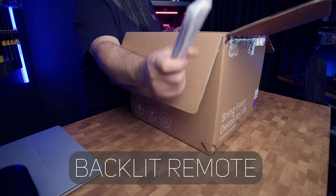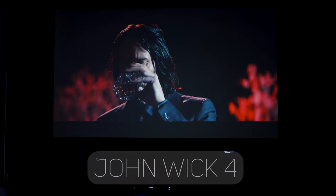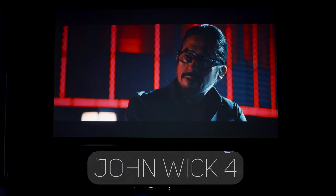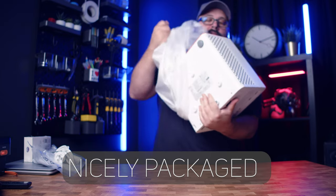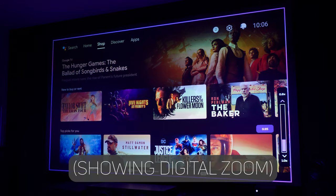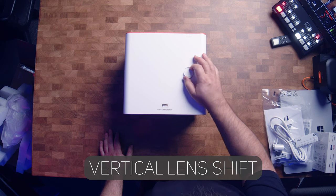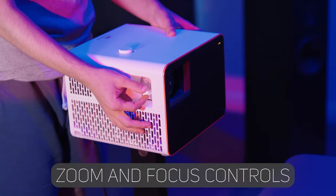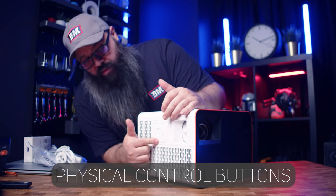This projector has the same light engine and internals as other BenQ projectors currently on the market, with the four-LED DLP light engine with support for the Rec. 709 and BT.2020 color space, using a 0.65-inch DMD, which makes this a true 4K display. We can expect over 30,000 hours of use time in eco mode. However, I'd suggest running in full power mode for best performance, which reduces lifespan by about 10,000 hours. The biggest and most obvious positive for me is that it has vertical lens shift and optical zoom, meaning you can place the projector where you need to and dial it in without using keystone or digital zoom.